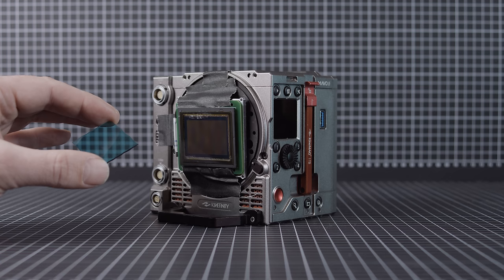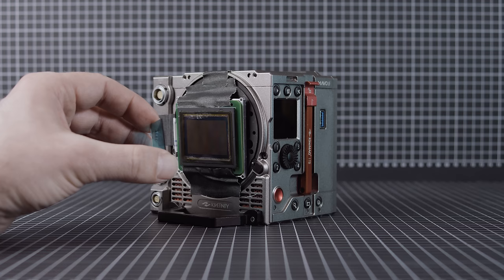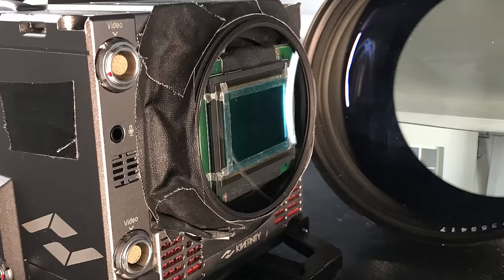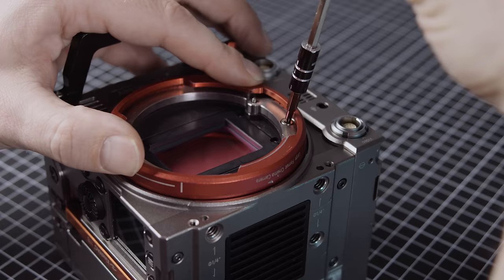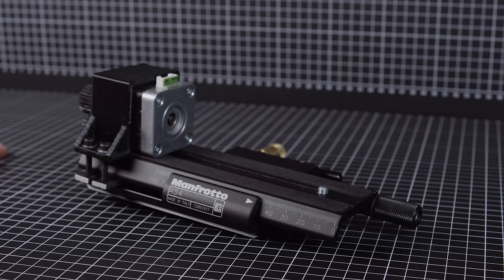To avoid Newton rings and scratching the sensor, the Kolari filter is attached leaving a small space between surfaces using double-sided tape. As this process is quite nerve-racking and I used the wrong tape — leaving some residue around the sensor surface — I'm not going to repeat it on camera. We attached the Kolari filter to a simple clear filter for protection, and attached everything with adhesive. It's not pretty, but surprisingly solid. And it worked! Everything we did here is easily reversible, and we did so several times over the course of this project. Most of this episode has been shot with the Mavo after de-modding, so the camera is fully functional.